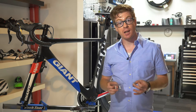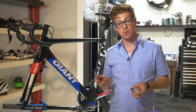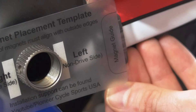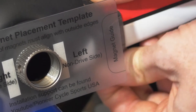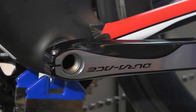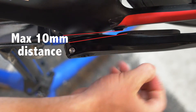You're ready to roll. The power meter does provide cadence using the built-in accelerometers, but for the highest precision you can use the included magnets. To do that, we're going to install them using the magnet placement template. Locate the proper magnet position by placing the template on the crank spindle and then temporarily tape the magnet on the frame. Now install the crank arm, gently give it a spin, and check that the sensor clears the chainstay and the magnet.